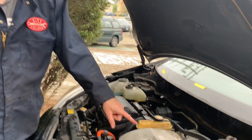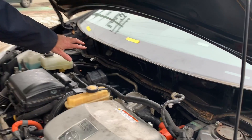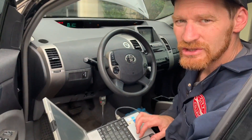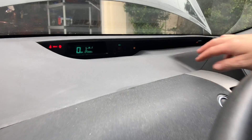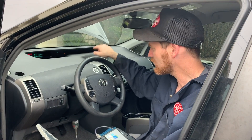The ABS actuator and inverter are back in. We're about to turn the car on to go through the bleeding procedure and check for leaks — we'll reinstall the cowl after. With the new ABS actuator installed, it was interesting to see that the warning lights all just went off. The brakes haven't been bled yet so the car doesn't have fully functioning brakes, but clearly something is better — the lights went off before we even cleared the codes.